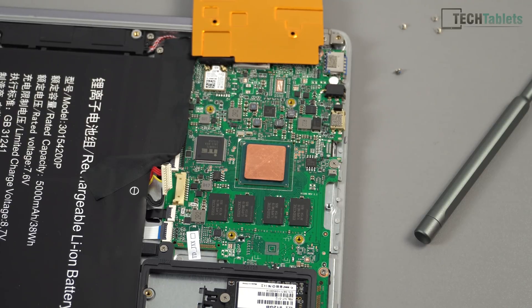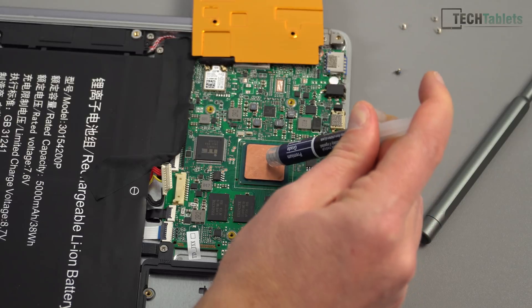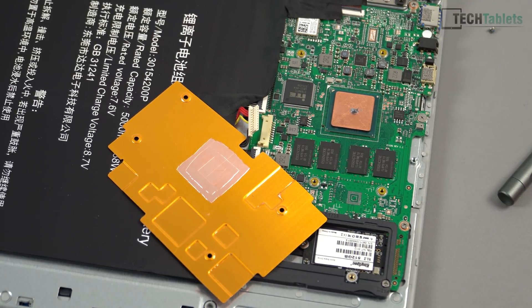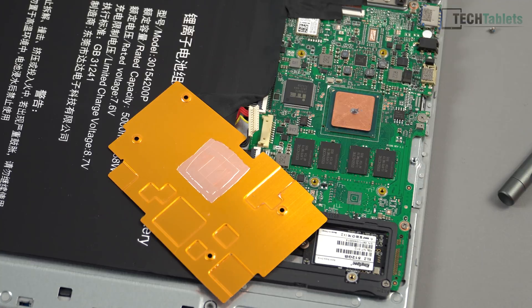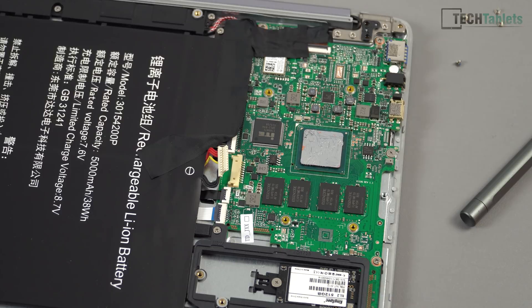Right in the middle of it I'm going to place just a very small amount of paste. On the back of the stock copper heatsink, I've just cut out a wider gap — originally made for the 15mm shim, then increased for the 20mm size — so it'll have flush contact with the factory copper heatsink. It looks a little crude but it doesn't really matter. I've spread paste evenly all over the top of the heatsink. You can put a big blob on top if you want. When putting the heatsink back on, make sure you put it on the correct way.